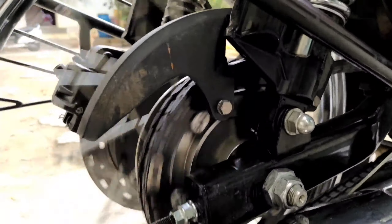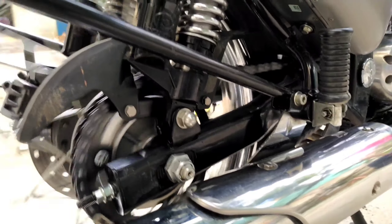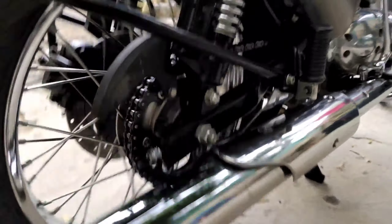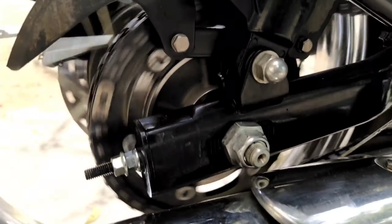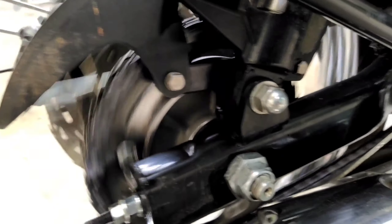Once you clean the complete chain, you have to just run the bike and make sure all the water is dry — it should be completely dry. Then you have to use the chain lube. It should be a light spray. Once you apply the chain lube, leave it for some time and do not ride the bike immediately. Let it settle for at least two to three hours so it covers the entire links, and then you can use it.